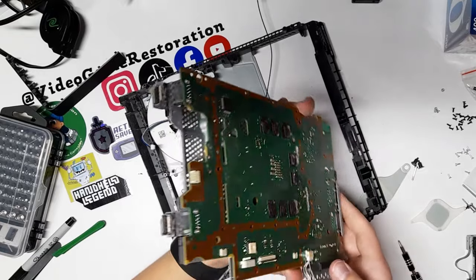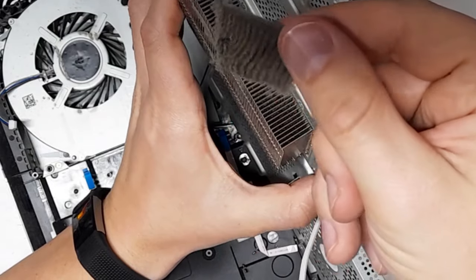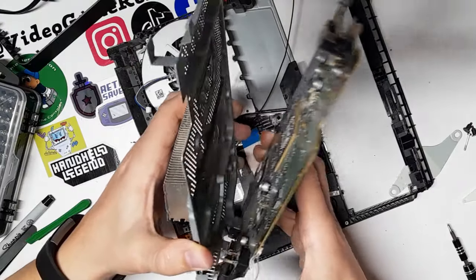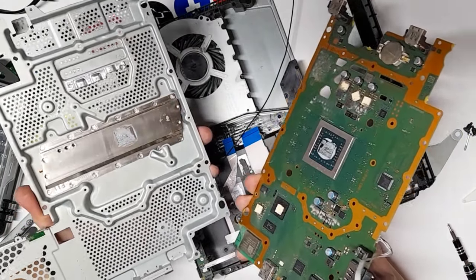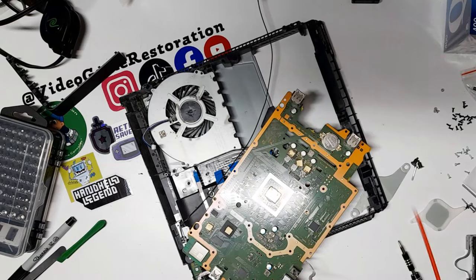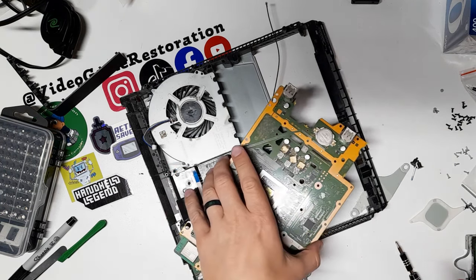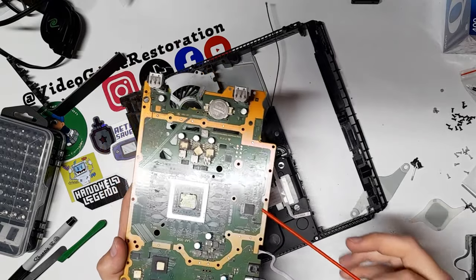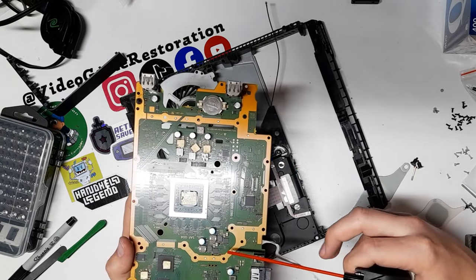Now the moment of truth — yeah, it's a little packed up. Well, that's your issue right there. I'm going to separate the board from here because I'm also going to replace the thermal paste and clean up the board in general with a little bit of isopropyl alcohol. I have a little bit of compressed air here. I don't use a lot of this, especially because there is moisture in these cans, so you need to be really careful. Just don't hold it upside down, and don't hold it down for a long time — just a very short little blast to get the big stuff off.